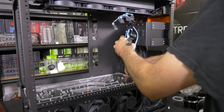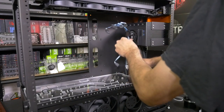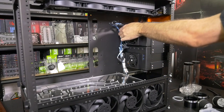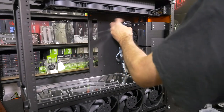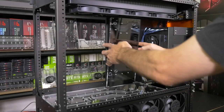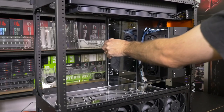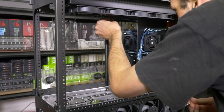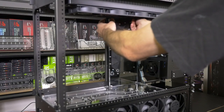We wanted to do some distribution plates. So we've designed a custom mid plate distribution plate and also a vertical one, which are really specifically for this layout because this layout is quite different and quite unique due to the drive bays. They're kind of for aesthetics but they're also reducing the size and complexity of the loop, the amount of tube that we need to use, and helping us work with the smaller space. But this is a huge case so there is still a lot of space, and we wanted to use traditional pump-res combos, Protium, to help fill out this space and balance out the aesthetics.